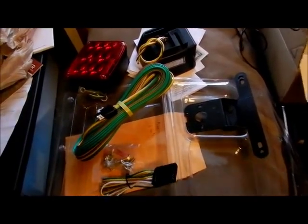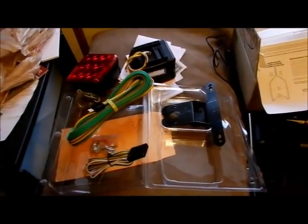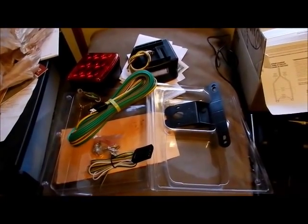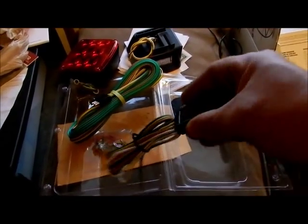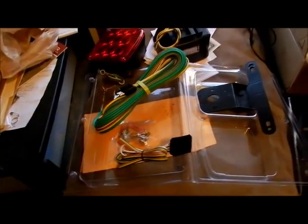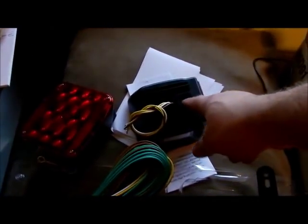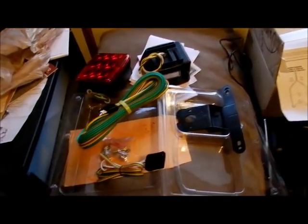It's a whole new LED light set. He said, hey, if it doesn't work, he has the receipt. This costs about $30 more than what I spent on eBay. So now we're going to de-install what's on there. This comes with the actual plug for the Jeep, for the vehicle, so I've got to figure out how to wire that in — probably just replace the one that's in there wire for wire. It's not grounded the same as the other one; it actually has a ground from each one of the two lights.